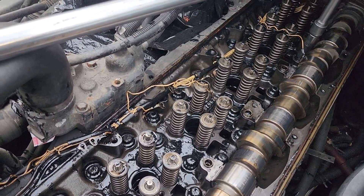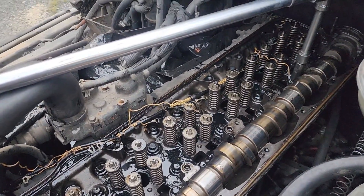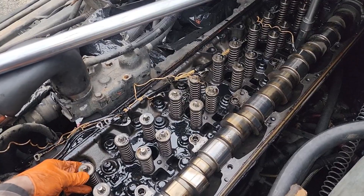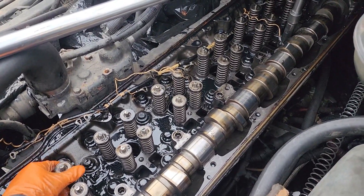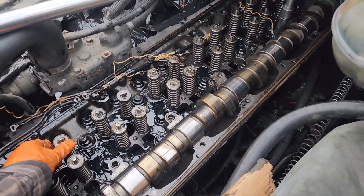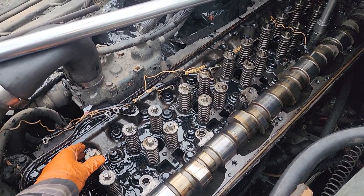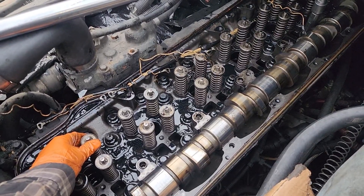For the older models — 97 and before 99 — the torque spec is 180 foot-pounds. I'm not sure why that is; when you torque it to 180 it doesn't really feel like enough. I'd feel more comfortable at 200 or so, but you do what you want. I'm also going to be ordering a special aftermarket head gasket — it's supposed to be a lot tougher than the standard head gasket and can take more abuse. I might have to replace the cylinder head — I'll have to see what's going on after I take all this out.